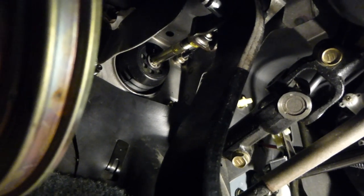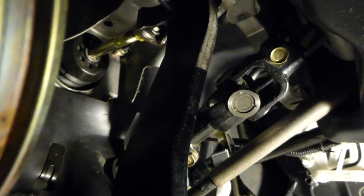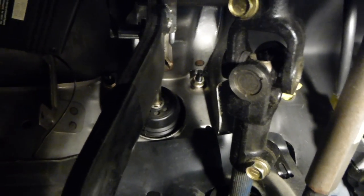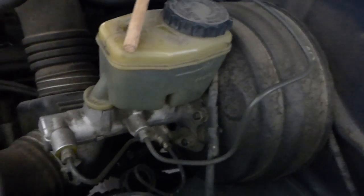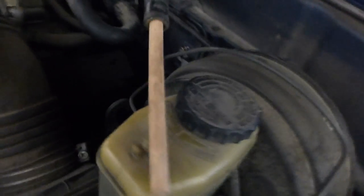It's pretty nice to be able to have a camera and take pictures of things you can't really see well, because your big head gets in the way. I can just take pictures and see how it goes together and hopefully get it back together the same way. I'm trying to get the brake lines loose enough to move the master cylinder out to get the booster out. But if I have to loosen the fluid, it's going to be a lot more trouble refilling and bleeding the brakes.